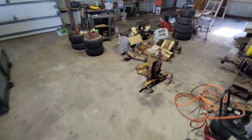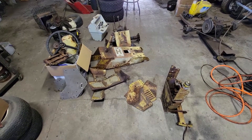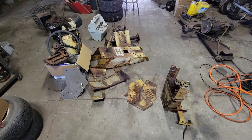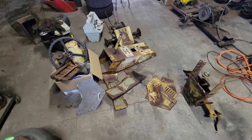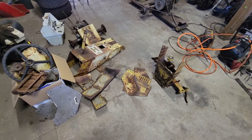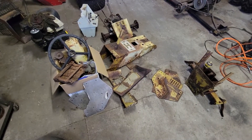First things first — the '74 SS-16 that I got a few weeks back. I tore it completely apart. I got the Onan engine actually unseized. All it was, was the flywheel was just jammed full of a mouse nest. So it actually turns over and has good compression. Cylinders look nice. It just needs a carburetor, ignition coil, and new head gaskets, because I ruined them when I took it apart.